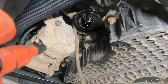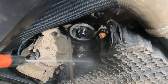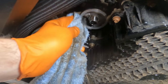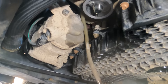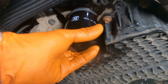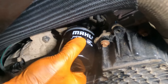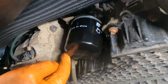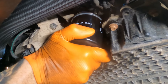Now I like to just give it a hit with brake cleaner. This thing has been neglected with servicing, so I just want to make sure everything's clean and clean up any oil spillages. I'll screw the new filter back on. I don't want to do this too tight — just hand tight. It does say 20Nm, and there is a hexed edge on the bottom here if you've got the correct oil cap to remove it, and then you can torque it up.